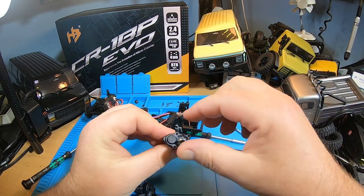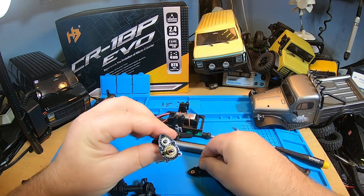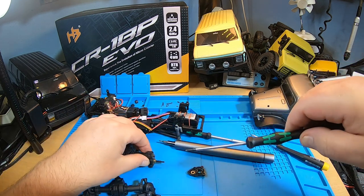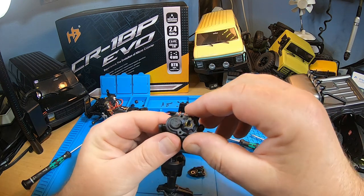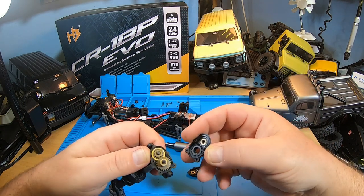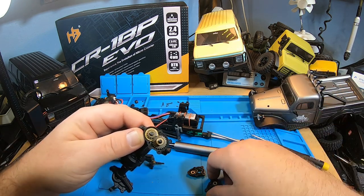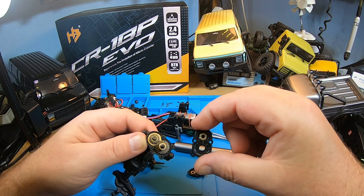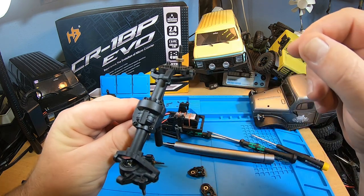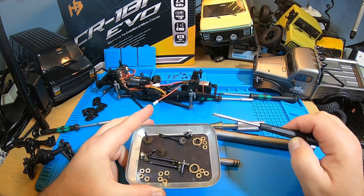Four Phillips head screws on each portal cover. I'll open it in front of camera. We will see the bushings here, nice metal gears and bushings, and super nicely greased. That's one portal cover of the rear axle, and here of the front axle, also nicely greased and bushings. Now I will totally disassemble and we check what bushings those are and what ball bearings we will need. And I will open the pumpkins to check the gears inside. So I will list all ball bearings needed to exchange the bushings in the end.